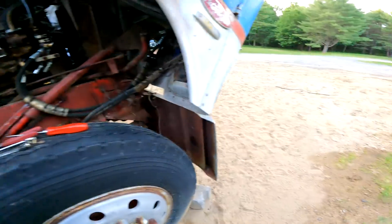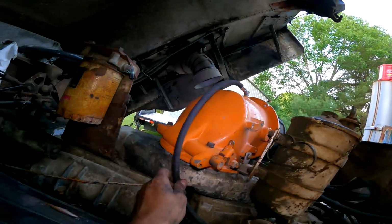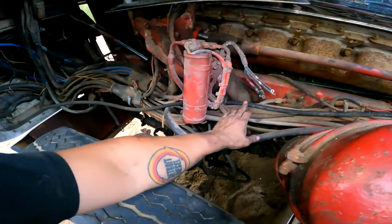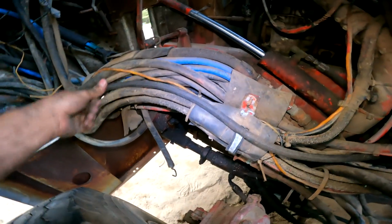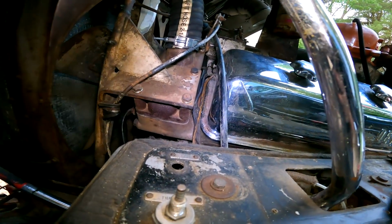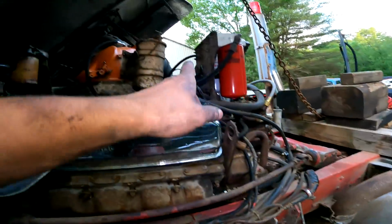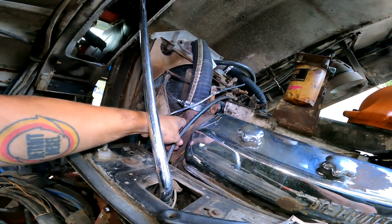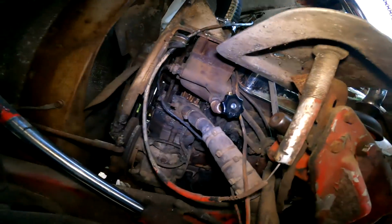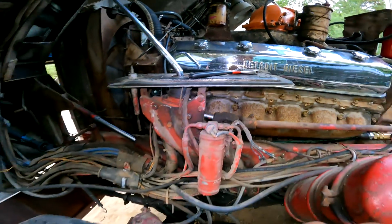The other thing I did was I got the line on. I ran the line up here for the intake gauge, and I came a different way with it. I came down this way and through factory clamps. A little bit of a change. It's plugged in, but I gotta do the dashboard side now. I didn't like it going up here because when you go to take this valve cover off, it's a total nightmare. There's like way too much stuff in there as it is. I ordered the silicone hose with enough to go that same way with the silicone for the coolant filter, and I'm gonna try to do that because it sucks to get this valve cover off. And I have more room to go back through that way with that silicone, so I may do that. But that's what we got there. Otherwise, it's got to come up through. I haven't made a decision yet.